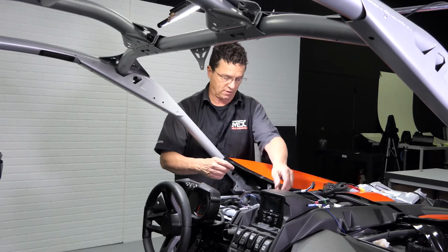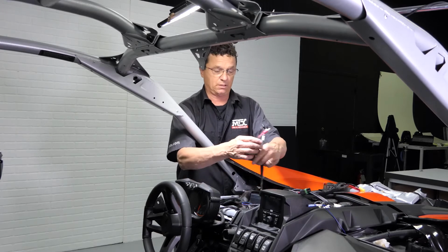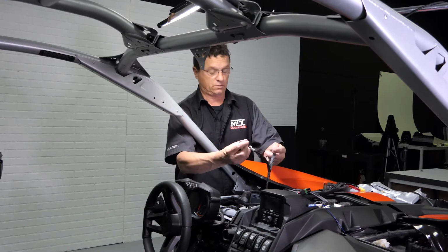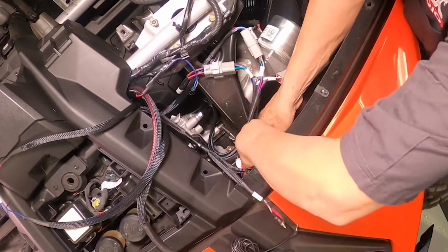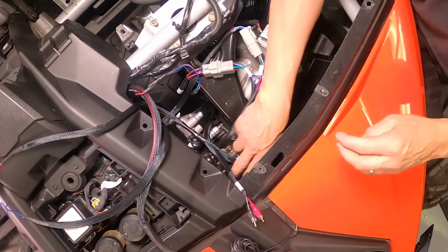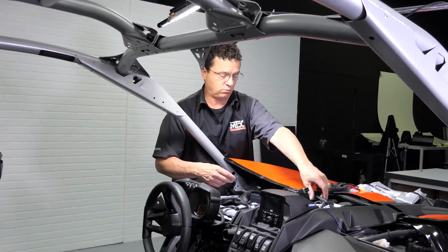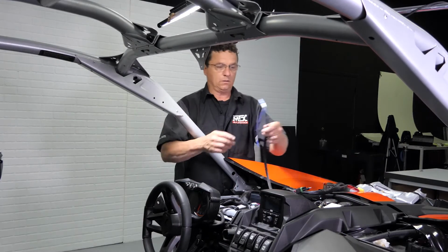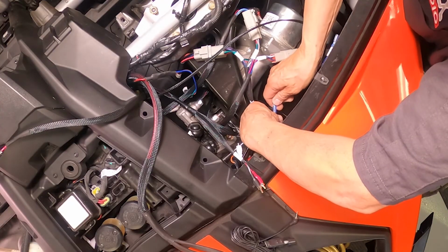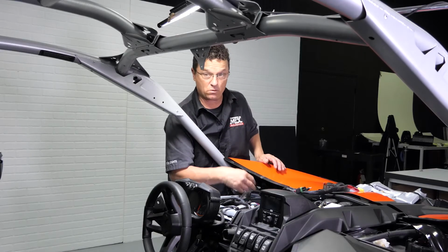So next, we're going to move on to the signal input, which is this black plug and this set of RCAs. Black plug goes to the 4-channel, RCAs go to the 600, or mono block. Okay. Next is remote turn on from the head unit. Blue wires. Doesn't matter which pigtail you plug in. That's done. So that's everything on the 4-channel except the power, which we'll do last.